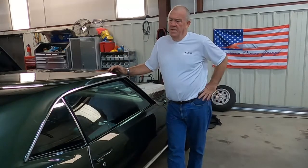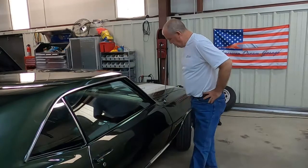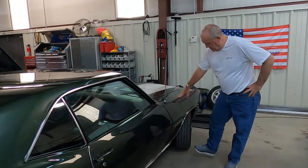They drained the brakes, and this brake in particular was very, very slow. They put in new fluid and bled them — only using a vacuum pump would not work. Only manual pumping of the brake would get anything out of this wheel, and even then the flow was marginal. I didn't know brake lines can deteriorate from the inside out. They believed the brake lines had deteriorated inside and were restricting the flow of brake fluid.